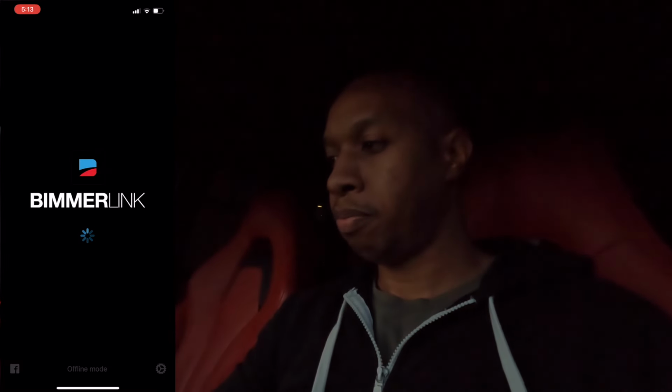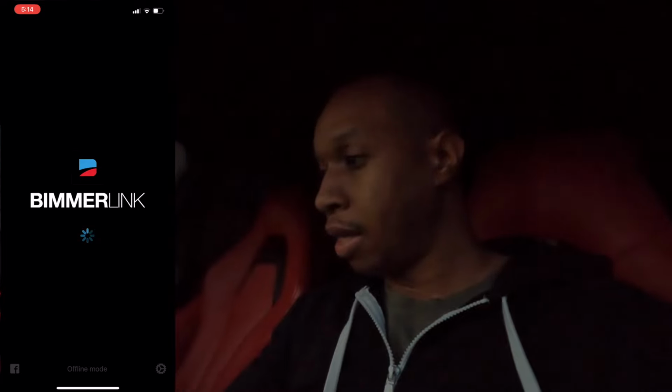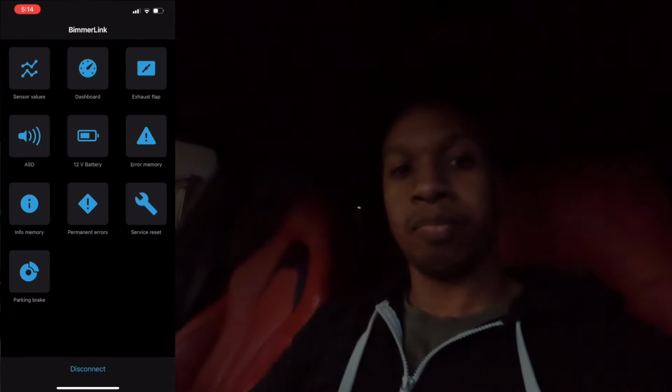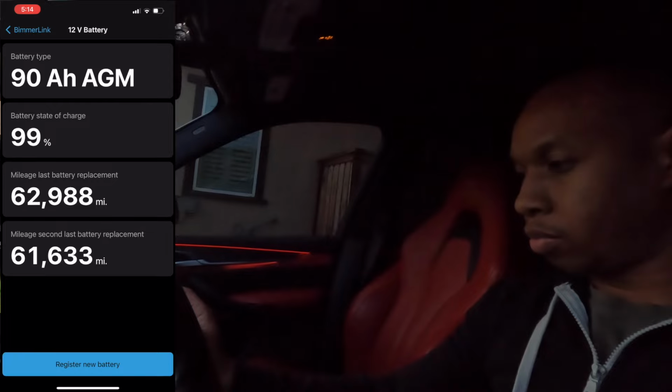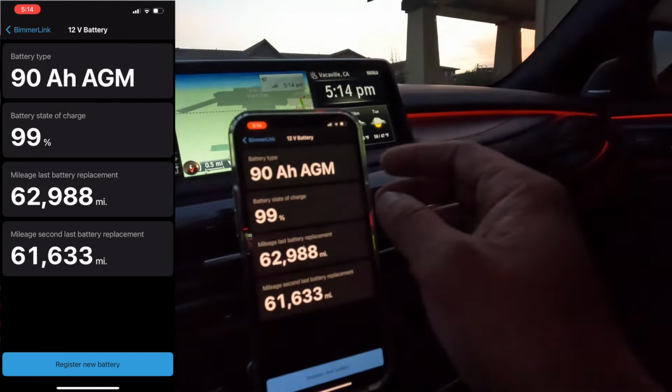So anyway, plug it in. I'm gonna turn my car on. So I'm gonna get my BimmerLink up. All right, so when it comes to the battery, you're gonna see obviously a few things. I'm gonna hit battery. It said battery type 90, 95 is closest to 105 or closer to 90. So I'm gonna hit register new battery.